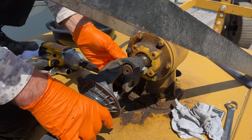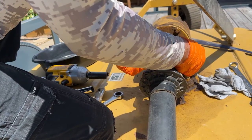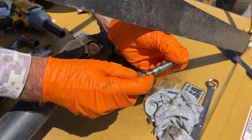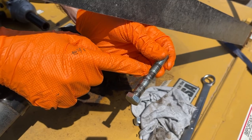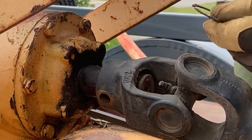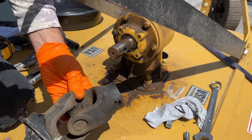The first thing I've got to do is get this PTO shaft off. We'll take a look at this shear bolt - you can see it has some ridges in it from impact from brush hogging, but it's not close to breaking. It's definitely reusable, but that's what happens with a shear pin. On my last brush hog there was a little retaining ring here, but this one has a groove for it with no retaining ring, so that came right off.